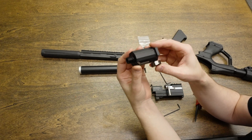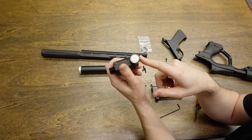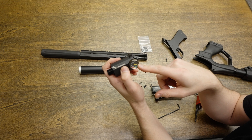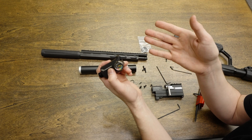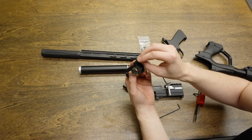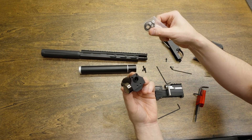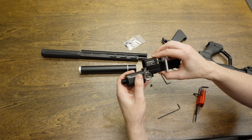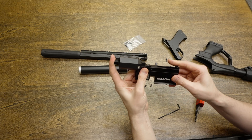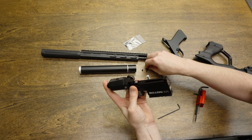It's time to install the plenum. This one has a pressure gauge installed on it just to demonstrate as part of this video — this does not come with the plenum, but they are available on Amazon; I got two for about $8. Search for M8x1 pressure gauge and you'll find a few cheap options. We've got to put an O-ring onto this side — spares are available if you need them. This is held on with spring tension pushing it away, so you kind of have to hold it while you install the screws.